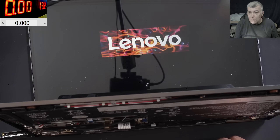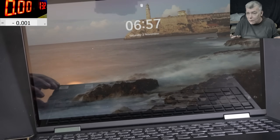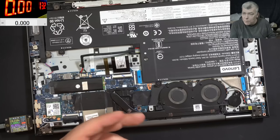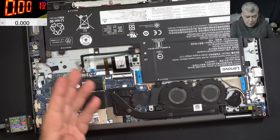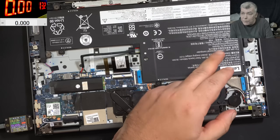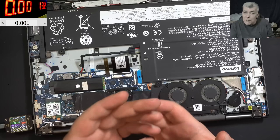It is possible they come back. If the customer wasn't using the laptop, my idea of what happened here: it was a corrupted EC chip or corrupted BIOS. The customer didn't disconnect the BIOS battery, and the board was still drawing power from the battery even while not working. The EC chip is always on, so it discharged the battery. For some reason the battery didn't get disconnected by the power management board, which is what's supposed to happen.